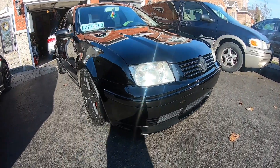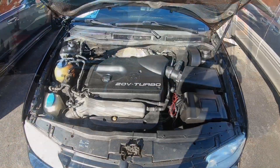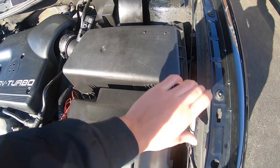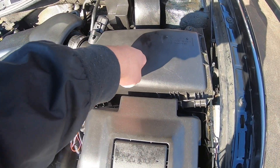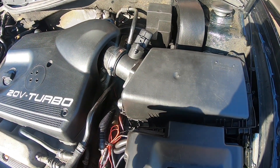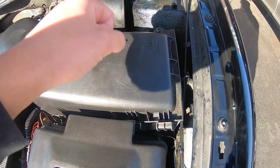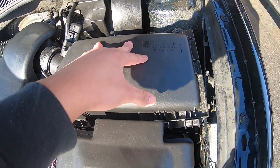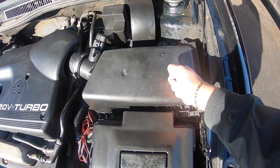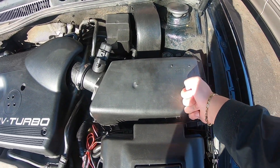Today we're putting on a cold air intake. So if you guys don't know what that is, it's basically the way the engine gets its air. This is the air box — all the air comes in from the outside, through here, there's a filter that filters out all the dust and brings air to the engine. More air makes more power, and you want cold air, not hot air. Cold air is more dense, so more air can go into the engine rather than hot air, and cold air makes you go faster — that's the main reason why people get cold air intakes.